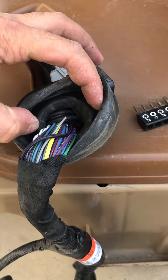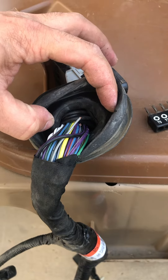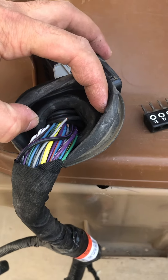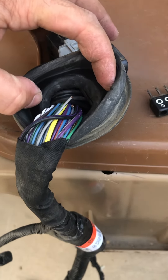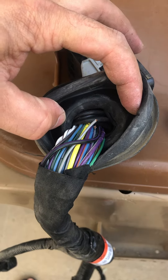I'm just going to show you folks here before you get too into a door actuator. If your door locks aren't working in a Ford — this one's a 2012 F-150 Lariat — just check your wiring harness first. It'll probably save you a lot of time because all the opening and closing typically happens on the driver's side or any door that you're using often.